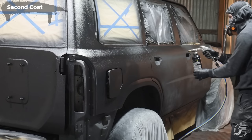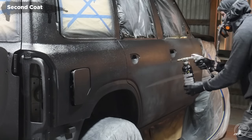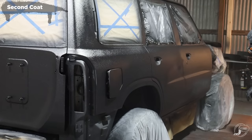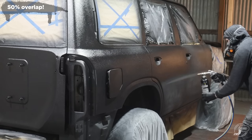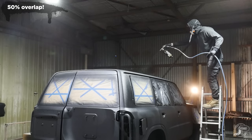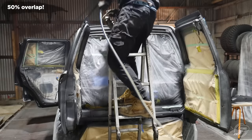It's time for the second coat and this is where you'll start seeing things come together. Notice I'm using a sweeping motion, flicking the gun at the edge so I don't leave any lines on the panel. At this point you want to keep a consistent distance from the vehicle — don't move in closer or further away, as this is building the final finish. Also make sure you're overlapping each spray pass by 50%; don't spray directly below the previous pass or you'll leave a line. Hit those hard-to-reach areas, the bonnet, roof, gutters, and window jams.